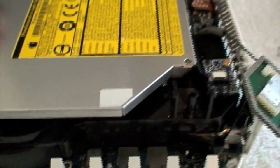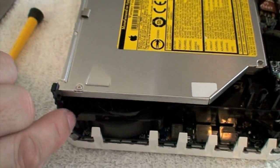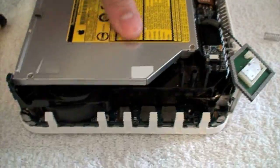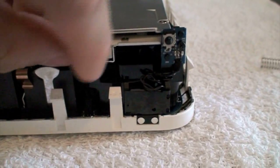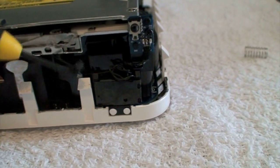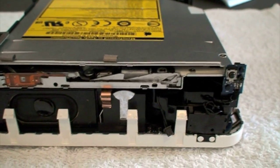On this machine, in order to take it apart, there are four screws that you're going to need, all around on each corner. One of them is longer than the other — it's this one here on this corner, that is the longest one — so you don't make a mistake when you put it back together. You also need to take out a cable right here that needs to be popped out. I recommend using a little tweezers, but you can actually do it with your nail. It's just a little plug — pop it off from there and remember you got to put it back when you're done.